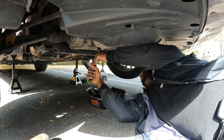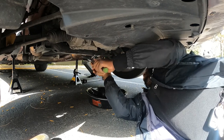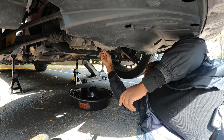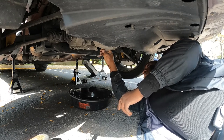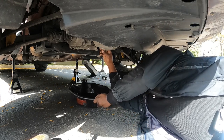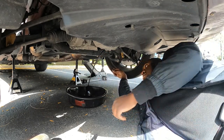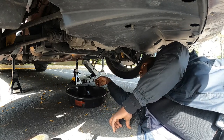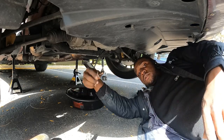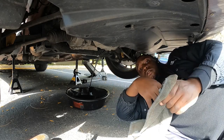We're back — it was a 13mm, and the dealership had this loose, so that was already loose. Good thing I didn't lose any oil. Always catch the oil when you unscrew the drain plug. You gotta find a sweet spot — it ain't always a mess, you gotta know the sweet spot. I'm gonna show you how to clean the oil drain plug too.